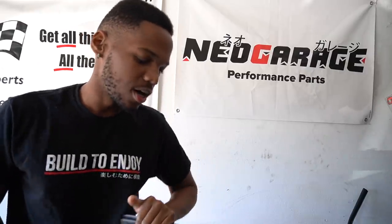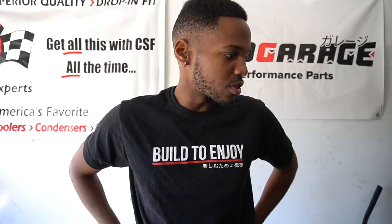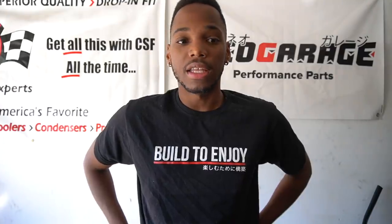I should have bought a slave too, but my slave is good. I have pretty good movement with my slave, so I know it's not the slave, it's the master. So that's pretty much what we're going to get into today. We're going to replace this clutch master cylinder, and then we're going to take the car out for a drive and see the difference.